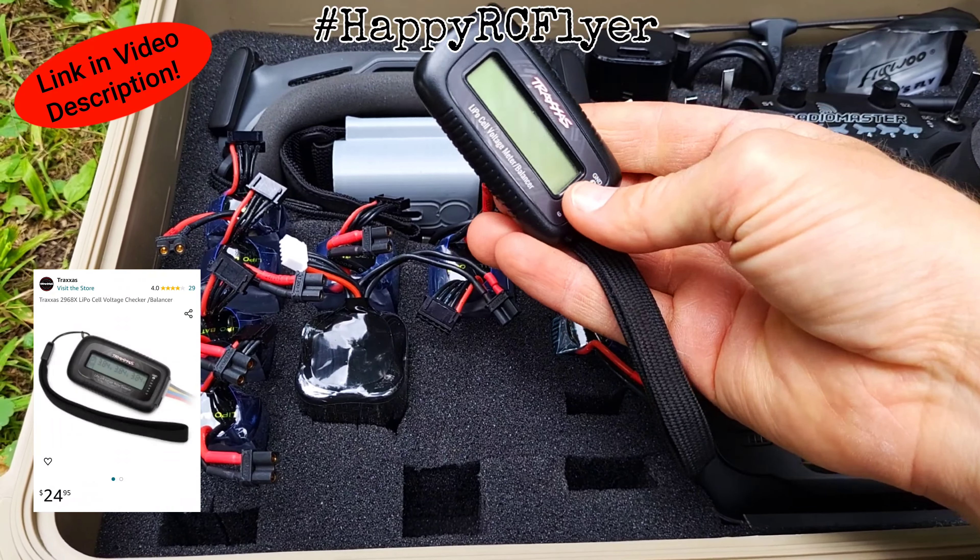Then I have all these cutouts for my batteries. I have some little 300 milliamp 4S batteries — those are for my Firefly, my little Firefly Nano, I think it's a 1.6. I can run these 300 milliamps on that, I can run them on the micro Draco as well as on this, which is the Flywoo Explorer. Here are all the 4S batteries: I've got some 950 packs, a Lion Pack lithium-ion 18650 that's a 3000 milliamp pack for really long flight time, and some 750s. These are all 4S packs — this is primarily set up for my freestyle 4S quads which are sub 250.